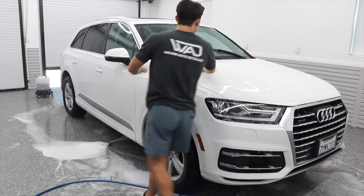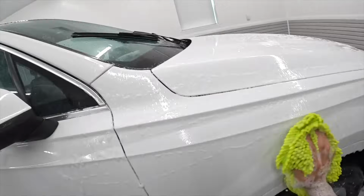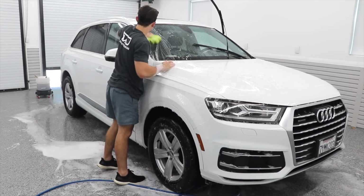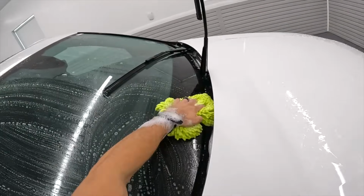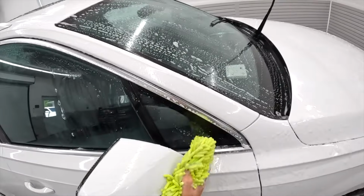Now, it is important for me to say that Muscle Magic is an extremely overbuilt degreaser, which means it needs to be diluted very, very heavily in order to maintain a safe concentration of the chemical. According to Superior Products, it's about 5 times as concentrated as a product like Purple Power. And because of that, we need to maintain a heavy dilution.